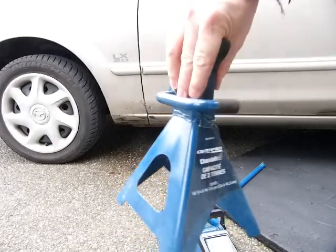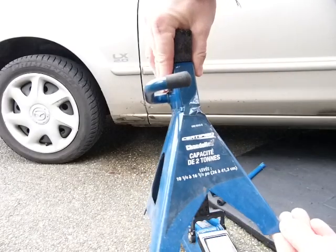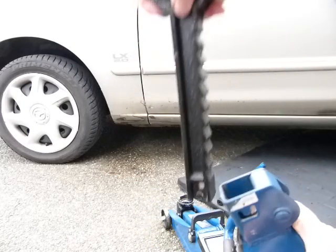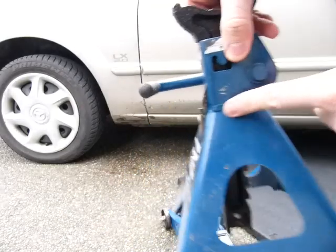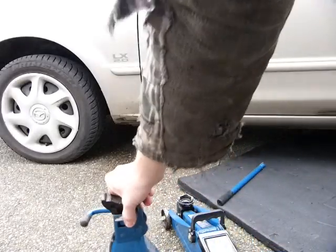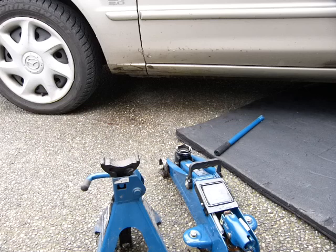Also make sure that the jack stand and the jack are not broken, not deformed, not bent, not misshapen. The welds should be intact. Pull out this piece — nothing should be broken in it. And if something does break or cracks, do yourself a favor and don't weld it back, even if you know how to weld. Once these pieces are bent and have been subject to extreme stress, they are not going to be performing like new. If they are bent or deformed, just don't use them. Cut them up so nobody else can use them.